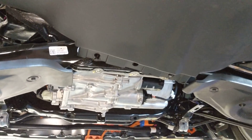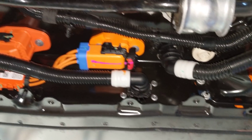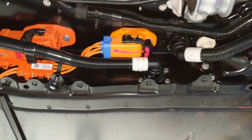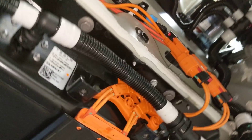Here we have the underside of the Model 3. The high voltage routing for the cabin heater and air conditioning compressor starts here at this four pin connector coming out of the bottom of the penthouse. The wires run down on either side of this protector right down the middle of the tunnel and then emerge.